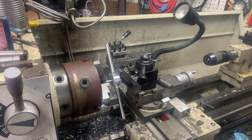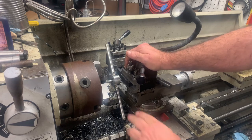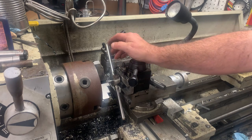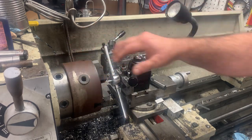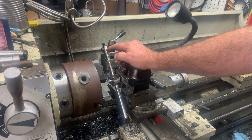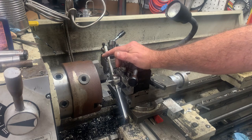So we're gonna finish the cutoff here. Okay, so I got started, but what I normally do with the tap is I'll bring my tool post back up behind my die or my die holder. And this is, by the way, how I cut my thumb. I wasn't very smart, but I bring it up, I put tension against it using a tool post and spin the lathe head. Like right now, it's in a high gear, so it spins with it. But I could put the gearbox in a low gear, like 70 RPMs, and it'll hold pretty good and allow me to tap until it gets to going up on there pretty good, in which case it'll get tighter and start to spin the chuck even at the lower gear ratio.